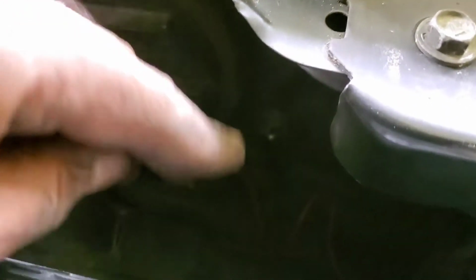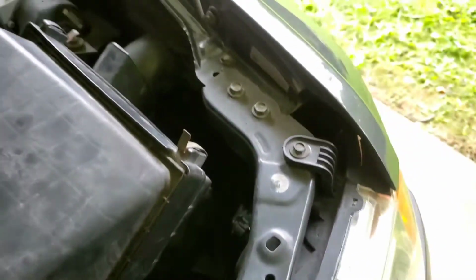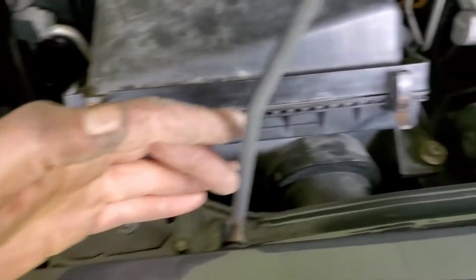The ground is connected to a ground. Didn't have to go crazy, peeps. It's right there. So I just found a chassis ground. Ground wire. It's pretty short. Anyway, the other red wire for the horn connects there. That all runs down under here, and then it accesses the firewall.